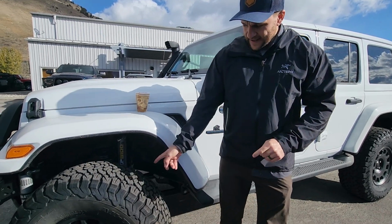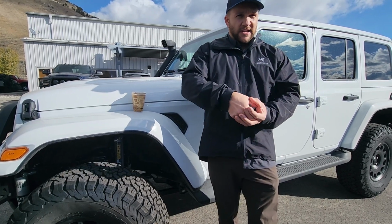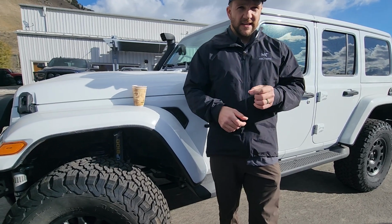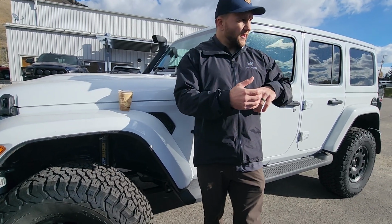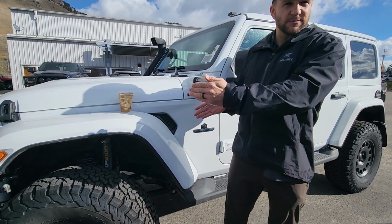If you take that shock out and cut it open, inside there's a whole bunch of what look like washers or 50-cent pieces, and how many of those are in the body of the shock and how thick each one is changes how the fluid can pass through the shock, and that's essentially how you tune a shock. So again, the tune is specific to each platform.